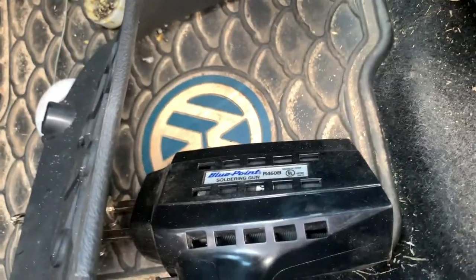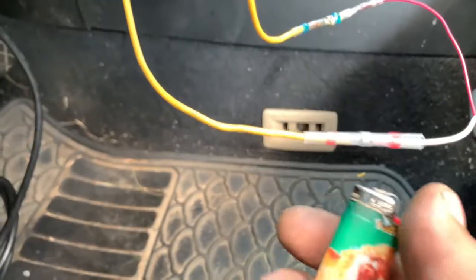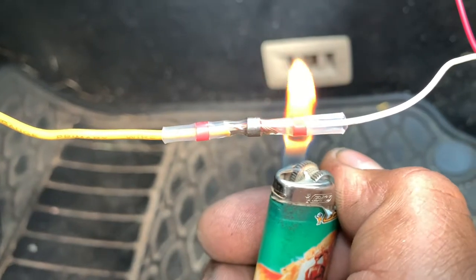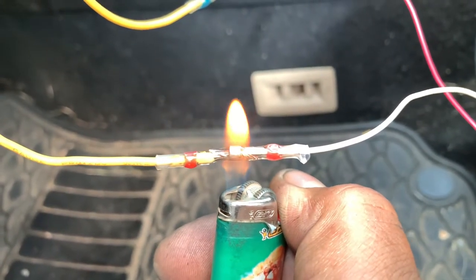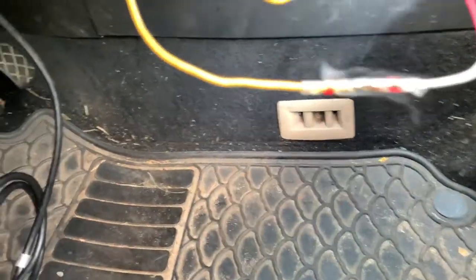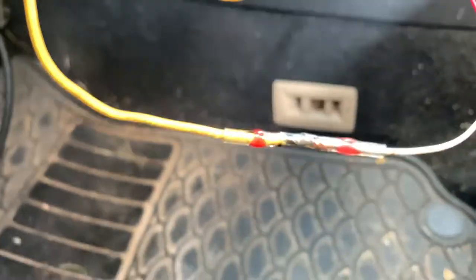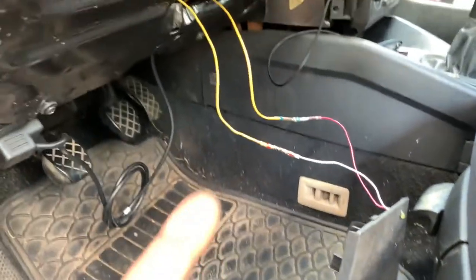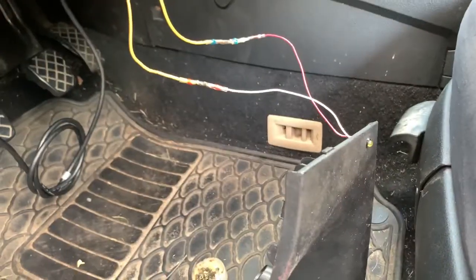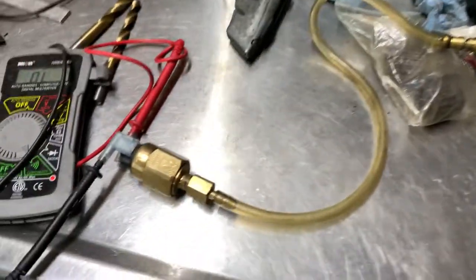Thumbs up for these quick connectors - I do use a solder gun but I like these quick connectors a lot. All you have to do after you put them together is heat them up. Seal it first so it doesn't drain the solder, then heat them up - and that's it. It does catch fire a little bit but you're good. That was it - the ground - and I'm going to ground it on this side of the car so it's solid. Now I just need to put it back together and I've got the light inside.